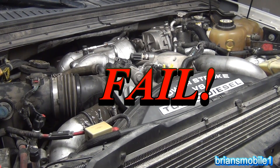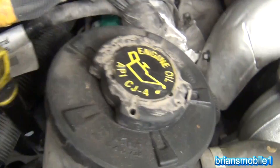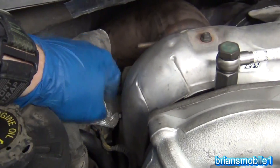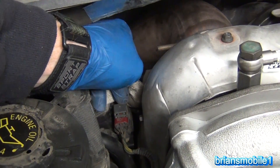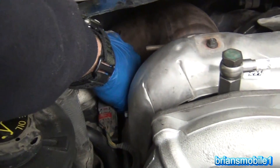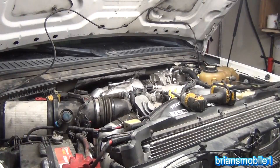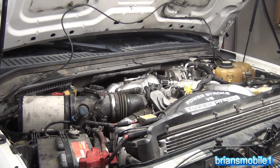Sounds like it's cranking too fast. Both of those codes are for the pressure sensors — for volume and for pressure. Underneath this heat shield, where it's easy to just overlook, this is unplugged. I knew I'd forgotten to plug something in, because I was so careful on every stinking torque spec and every single thing, but this one is stuck underneath. There we go — that's how it should look. I'll click that in and cover it up. This should fire right up. Man, that can be frustrating. Did I even get that on camera? I did. Victory.